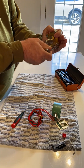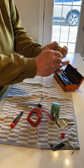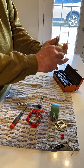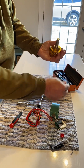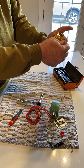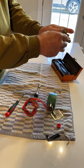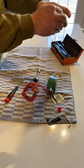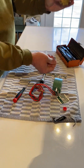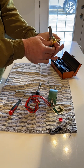The kit should come with new bolts — these bolts actually have built-in lock washers. You can use an impact wrench to break them loose, but depending on how old the solenoid is, you might shear them off, so it's usually safer to do it by hand. I'll use a tool to get them started, but I'll go around and tighten them back on crisscross — just like you would to tighten a gasket back down. Pull the four bolts off and the whole thing will come apart.